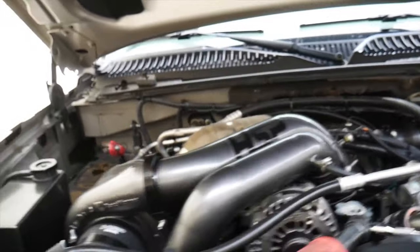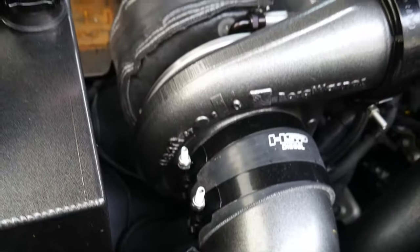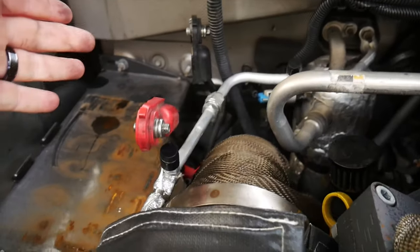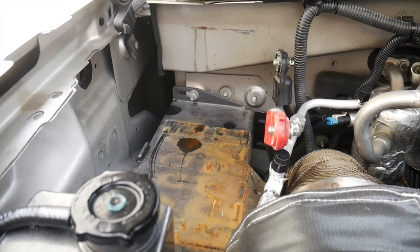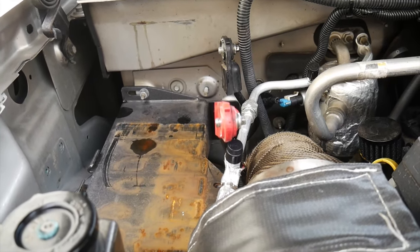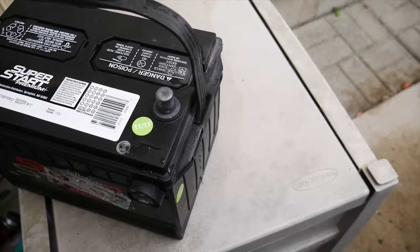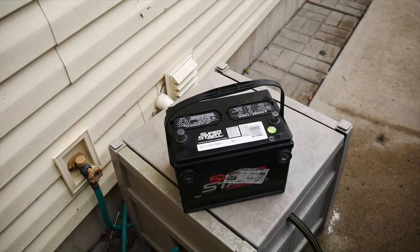And then I got to thinking, well, I had all these issues with my AC and other stuff over here because earlier on, before one of the videos, I didn't have anything wrapped on the exhaust side of this big old turbo over here. And obviously with the exhaust portion being right here directly next to the battery, it could have had something to do with the demise of that battery internally, getting extra hot, getting extra cold, going back and forth in temperature cycles so much. Hey, it wasn't enough to bow out the battery or anything. Like we don't see it bulging out too bad along it, but more than likely, I'm gonna say that's probably what caused it. So we're gonna need to remedy that. Well, that's something we shall have to remedy, isn't it?